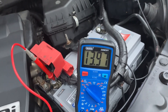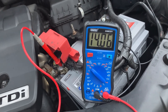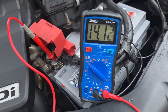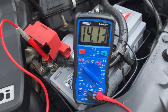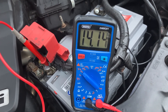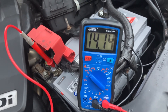At the moment we're getting a reading of around 14 volts. As current flows around the circuit and gets less resistance it will build up a little bit, so we'll let that stabilize at around 14.1 volts, which is okay but it's a little bit on the low side. The alternator on this car is at least five years old, so the brushes between the stator and the rotor might be wearing out, reducing contact and therefore not being quite as efficient.